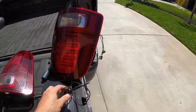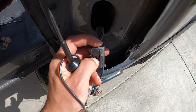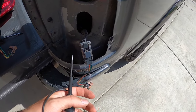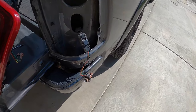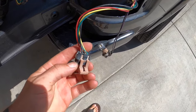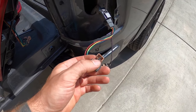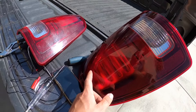I was getting the turn signal indication coming from the harness. If you're curious, you'll see the black wire here — and then the wire right next to the black wire, that's your ground. The one next to that is your turn signal. I tested it with a test light and it checked out. Your black wire is your ground, and you just probe it — I'll check exactly which one in a second. I was getting power here.